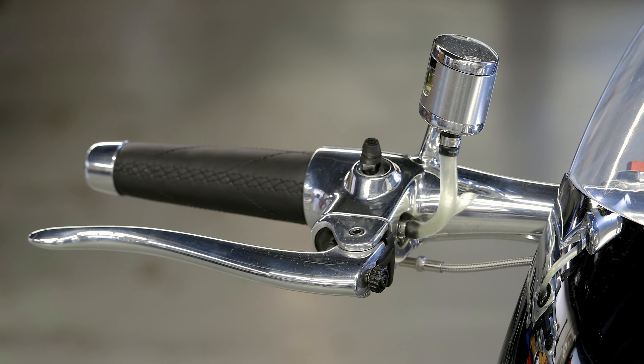To run the engine there are a handful of factory Ducati sensors integrated into this custom wiring harness, required for the Microtech ECU. The reason we chose the Microtech ECU is that Ducatis from this era have an immobilizer feature — an ignition switch and key that have to talk to the ECU before the bike will run. Rather than fight with reprogramming, and since we have a custom exhaust and custom intake requiring tuning anyway, we went with the Microtech ECU which is fully programmable and ties in with all the factory sensors from the Ducati donor bike.